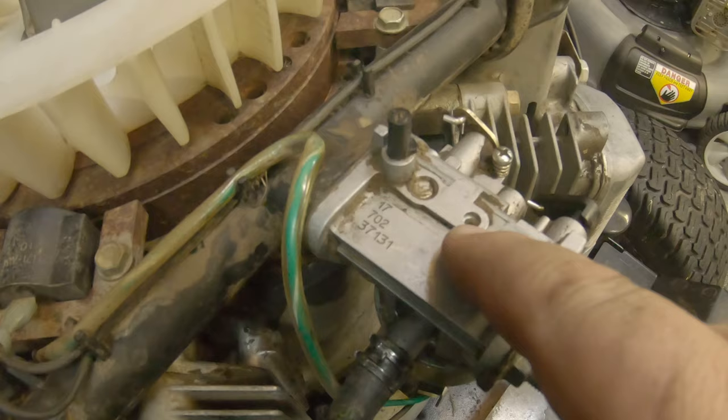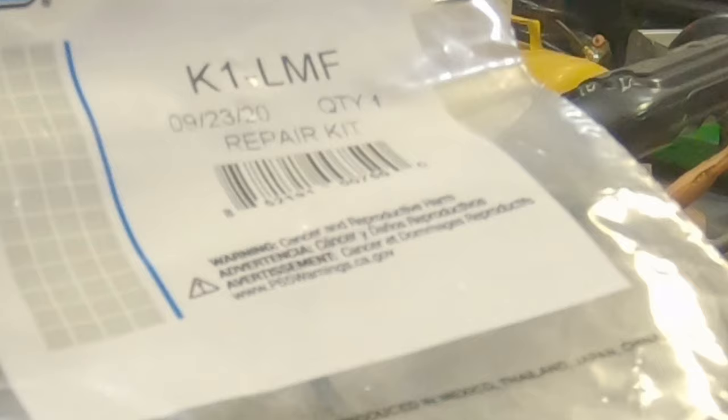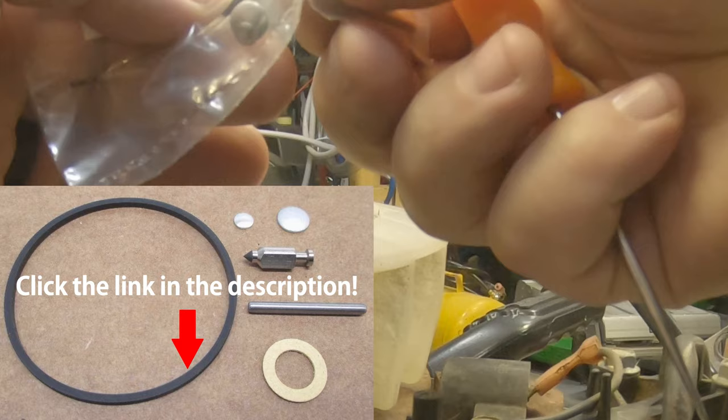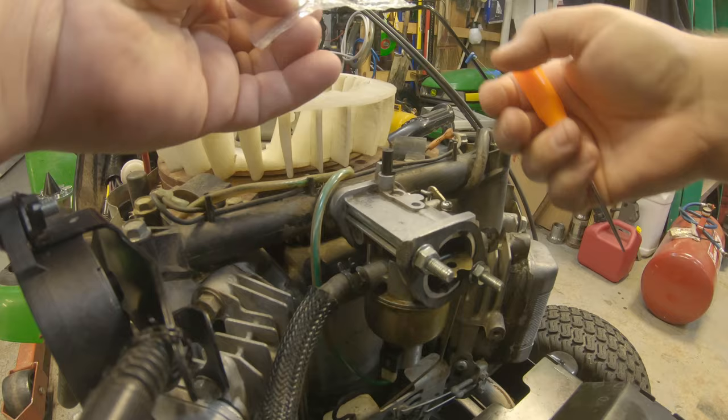I might have to do a little more research and see what that hole right there is, because if I put my finger over that, it doesn't surge. I do know I've got a carburetor kit here for this carburetor — it's a Walbro K1-LMF repair kit, and it does come with this piece. In fact, it comes with both pieces — there's a bigger one here and a smaller one. It also comes with the bowl gasket or washer, the rubber part that goes around the top of the bowl, new needle and seat, and a pin. I'll go ahead and pull this out of the kit and get this piece put on here, and I think that'll take care of our problem.